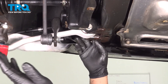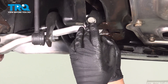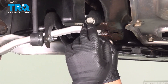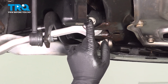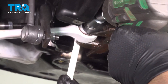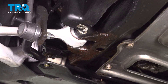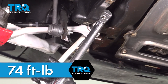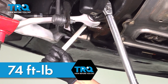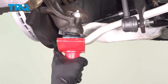You want this as close to ride height as possible to tighten this down. It would be ideal if you could put the wheel on and torque this on the ground, but it's not the easiest to get a torque wrench on this bolt while underneath the vehicle. Now we're going to tighten this down using an 18-millimeter wrench and 18-millimeter socket. Snug that down first and we'll torque this to 74 foot-pounds. Then lower the pole jack.